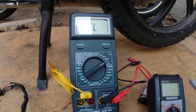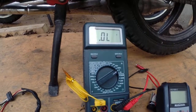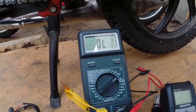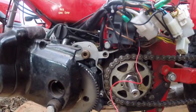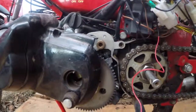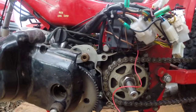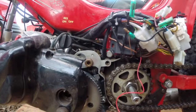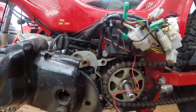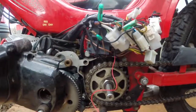Probably a little more than I should have spent, but it was there and I had the cash, so there you go. Now I have to pull this apart and find out either what's wrong with that coil, or maybe throw an 835 flywheel in there — an 835 flywheel makes everything a little lighter and a little smoother too. We never had any starters or anything like that on there, so yeah, there you go.